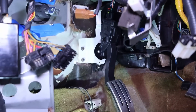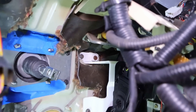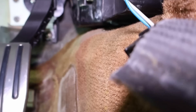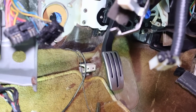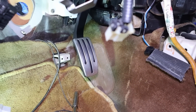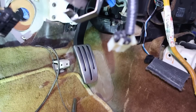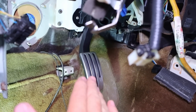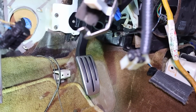We've also been working on the accelerator pedal — this is again from the Tesla, and we were able to utilize essentially the mounting points from the existing pedal. We've also got some additional mounting points up top and one more down there. It feels really good in the 3D printed material, and it's going to feel even better in the bent metal one. One additional thing we're going to add is a pedal stop, which is important because if anybody's ever been racing, there's always a point where you feel like maybe you can push a little harder. We don't want somebody to deform the metal bracket, so we're going to include a stop — just a tiny bit after full pedal — so if they keep pushing it can flex a little and hit that without damaging anything.